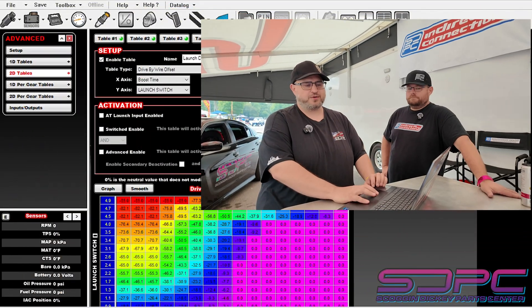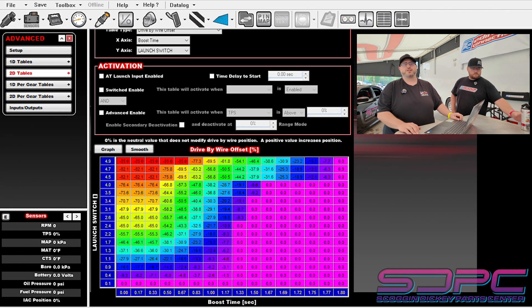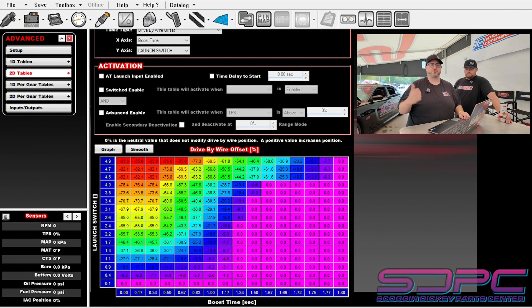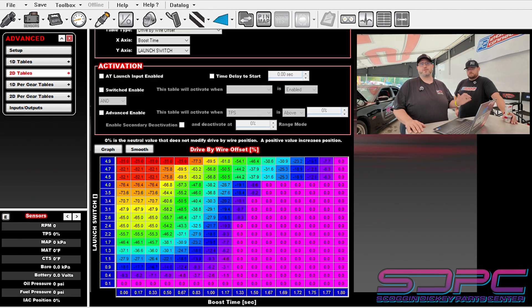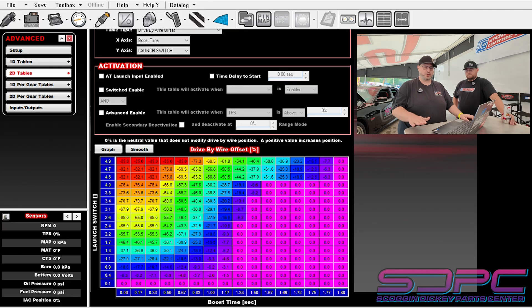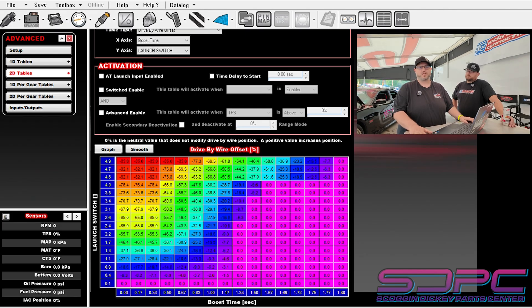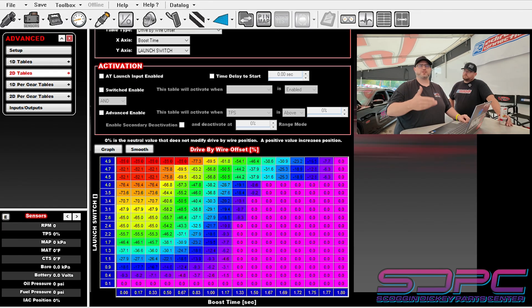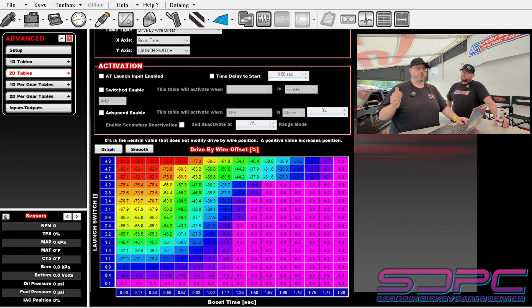We developed a table — no rules, this is just one I came up with that Gordon modified for his car — using a simple 12-position switch. Each position represents a different throttle ramp. You get on the two-step on the foot brake, hold your foot to the floor, and the ECU logic handles it: be at 20%, 30%, 40% throttle. When you let off the brake, a timer starts and it rolls into the throttle for you. As you turn up that knob, it rolls in more aggressively. It's all user-adjustable in the software. That's how I set up customers — go up for a more aggressive launch, go down for a less aggressive launch.